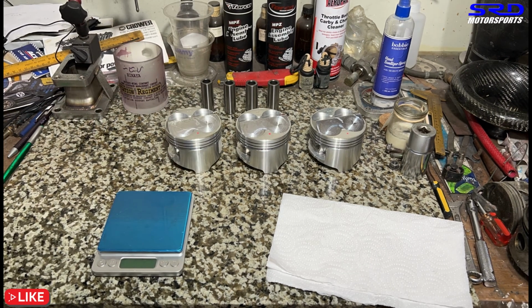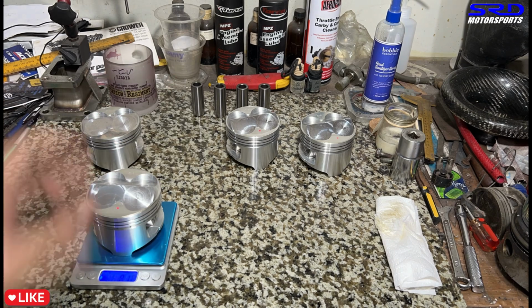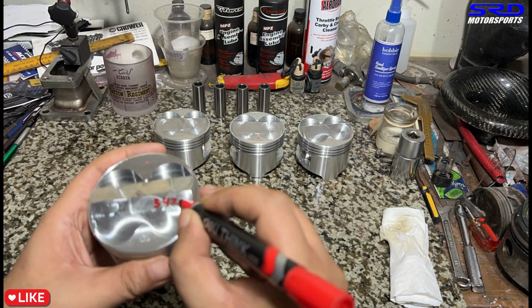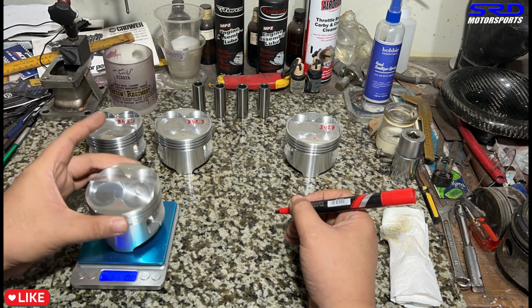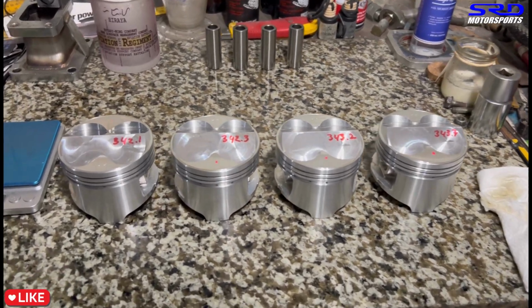All right, set this aside here. Keep it in order. Clean it, make sure there's no oil. Double check. We read it like 2 or 3 times just to be sure. Now we're sure, so we write the weight on the dome. Also write it on the notes that I save, but for ease of assembly, it's always on the dome itself. I learned that from Spoon Sports.